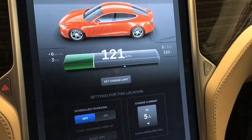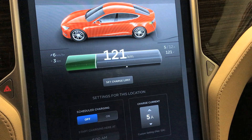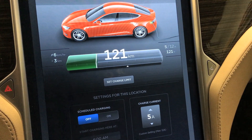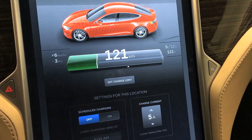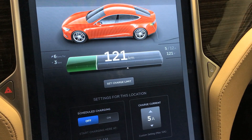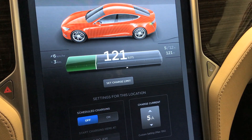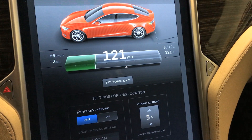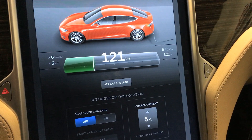The only thing that comes to mind you might want to be aware of is if you're charging — I'm in Canada and it gets cold here in the winter — if you're charging on a 110 outlet in the winter, the 12 amps, much of that goes to battery heating. So if you're connected to just 5 amps and you're charging, you might not actually get any charging at all. The entire 5 amps might go just to battery heating, depending on your conditions.